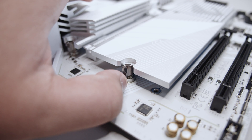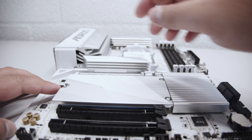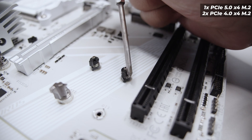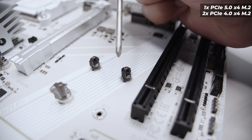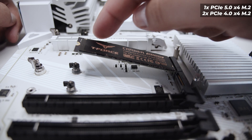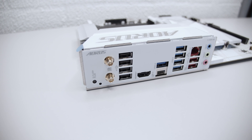There's a spring-loaded clip for the M.2 heatsinks here which is really nice. It's completely tool-less — you can open up that latch and lift up the entire heatsink, and underneath there are spring-loaded clips to hold drives down as well. The top M.2 slot is much the same, just a single heatsink with that latch. To install a drive: place it in, push it down, clip it in — you're good to go.